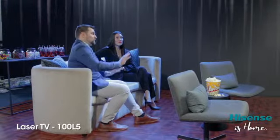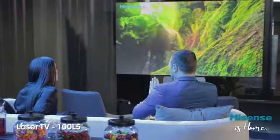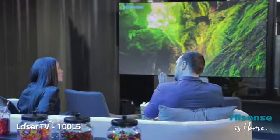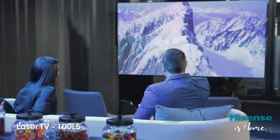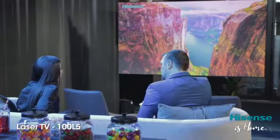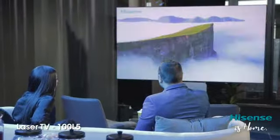It's gorgeous. That is because of the panel. Actually, the actual panel design, we use a Fresnel panel. We call it a Fresnel because of the effect that it gives off. Inside of that panel, you've actually got little rows that are angled in specific ways so that your laser TV system gets projected on there and it only reflects the light of the laser TV back towards you instead of any ambient light. So in light environments, this is absolutely perfect.